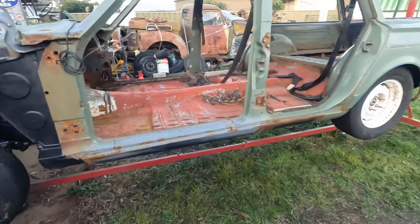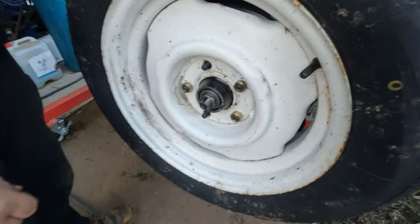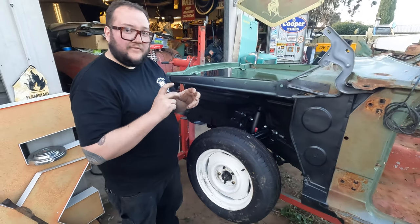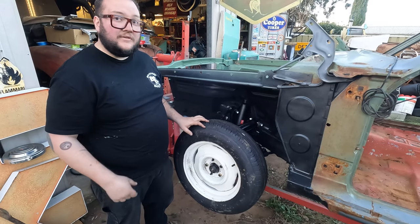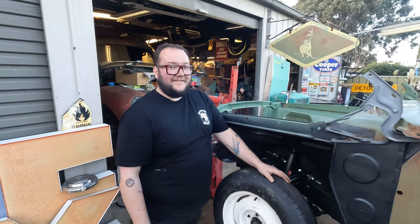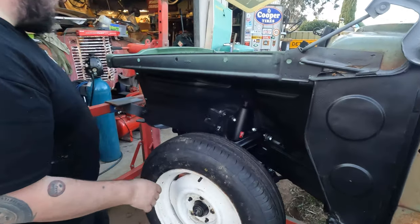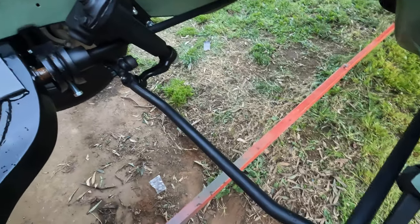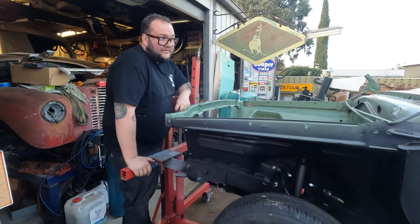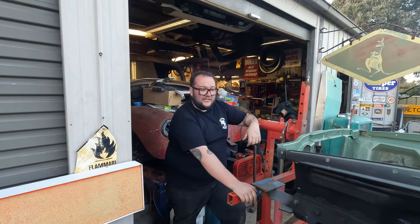It's time to bring it down. The front end's all in. I would like to get it off. Before we get it down, we'll adjust the wheel bearings. One thing I didn't mention the other day was the reason why there's a keyway and the washer — what the keyway does is stop the washer from spinning, so the rotation of the bearing has no effect on the outer nut, so it doesn't undo itself. Shout out to Jason for that tip. We rookie-aired it — someone pulled all the steering apart and didn't look at it, and no one took note of how it was. It's all back in there now. The only things we don't have in are the front radius rods, everything's still loose, but we can put the radius rods in at any time.